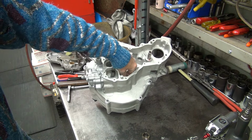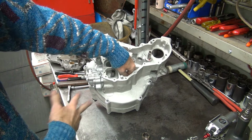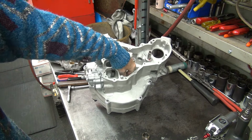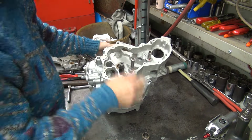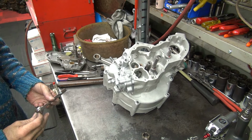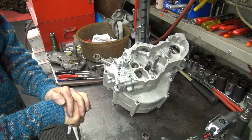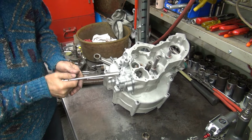It was tighter before with two gears in there. And all the bolts are tight now too. Before all the bolts are tight, you can barely move it. So I'm turning it with my fingers. It's snug, but I'm pushing it through, but it's rotating all the way around the whole thing. Alright, so that tells me the outer pair of gear isn't too bad. The inner one, I think, is the one that's dragging just a little bit right now.